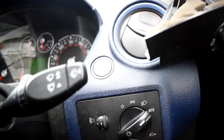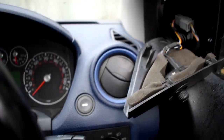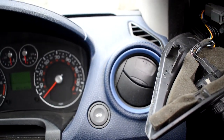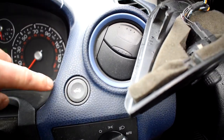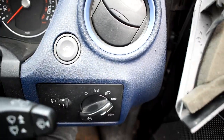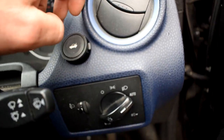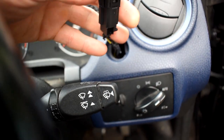It's a bit awkward, so there's two ways you can do it. You can either get a flat screwdriver or something you can prise with — preferably a plastic tool so you don't damage the car — and get behind this and pop the button out first. Or you can fish your hand in this hole and you should be able to push it out. With my hand in, I was able to just push the button up and pull it out.